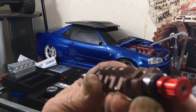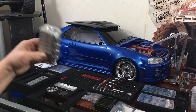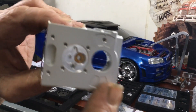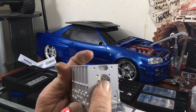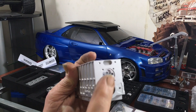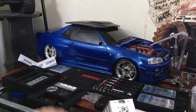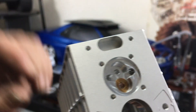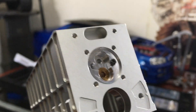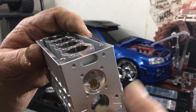The crankshaft already has the seals on it. Make sure you put some grease on it before you slide it in, and put a little grease inside the boss of the block to help it go in so it doesn't tear the seal. For the water pump, they give you two big round gaskets and you have to use both of them — that's why my test start leaked, because I didn't have both gaskets in. The gaskets have to fill that little recession to keep the fluid from coming out.